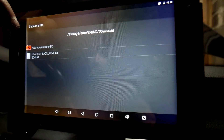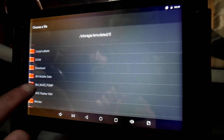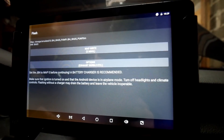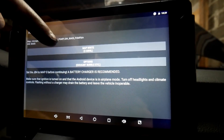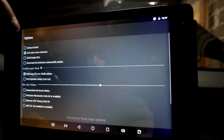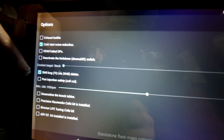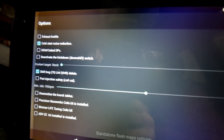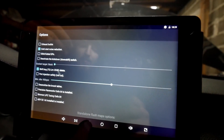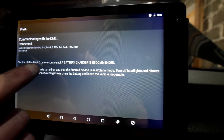Once you do that, go to 'flash a backend flash.' Select the right file — I'll do JB4 i8aos pump — click on that and it's going to say 'contacting DME.' It will pop up and give you the option to map right. You also have options: exhaust burble, shift bog — which lets you bounce off the rev limiter — and cold start noise reduction. I'll keep cold start noise reduction and shift bog selected.